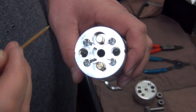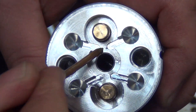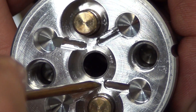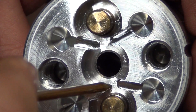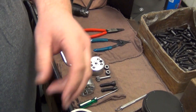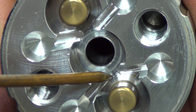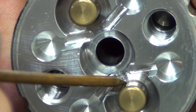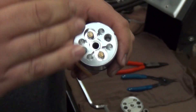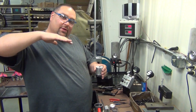After removing the gears, using a wooden pick — not a steel pick because you'll scratch the aluminum — we will run it across both sides of the pocket to feel for a step. There is a very slight step here which is normal. Now here is a bad one: as I run my pick across there, there's a big step. The drive gear has eaten down into the body, which allows the gear to be pushed up and the fluid to bypass underneath.